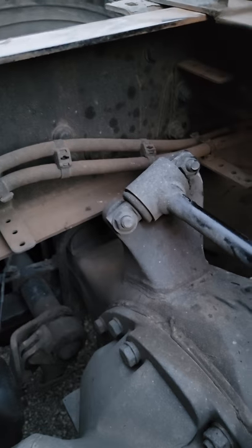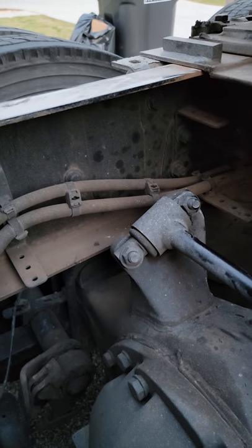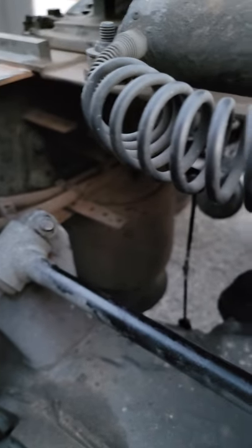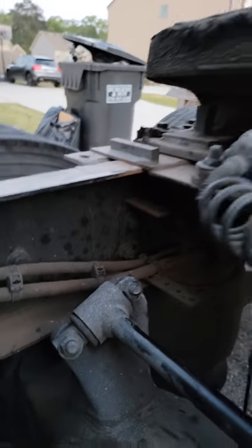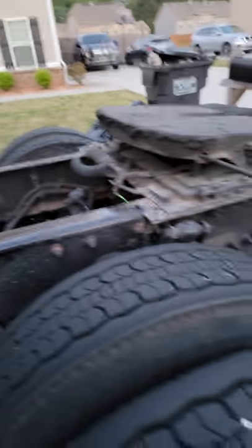What I was getting was like a tire balance issue — like my tires needed to be balanced in the back, like in a car. I'm telling you, it's night and day. This drive shaft is straight right now. Before, it was tilted. Night and day — I have no vibration in the truck now.